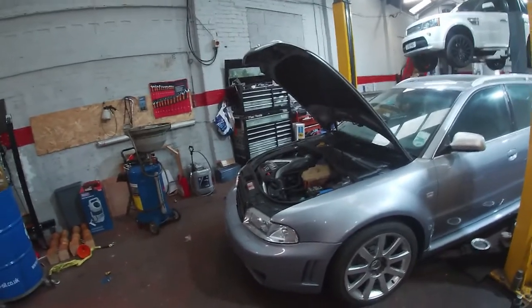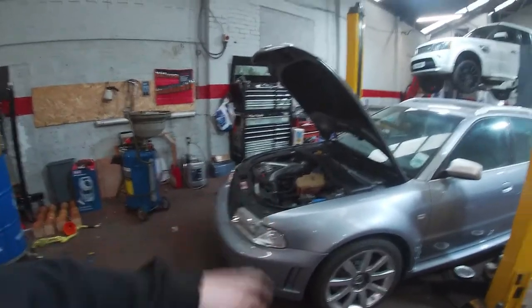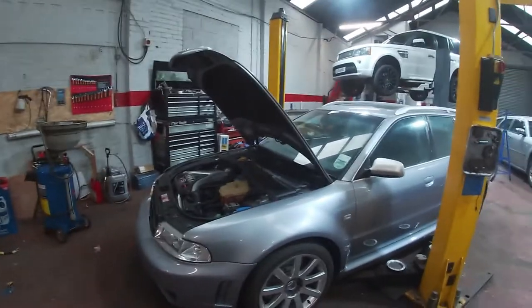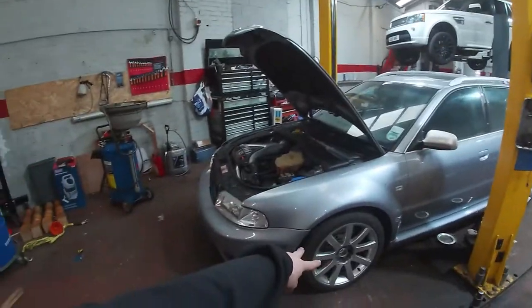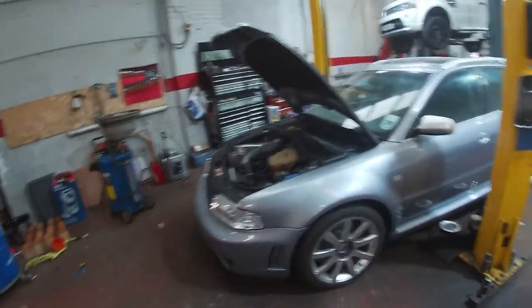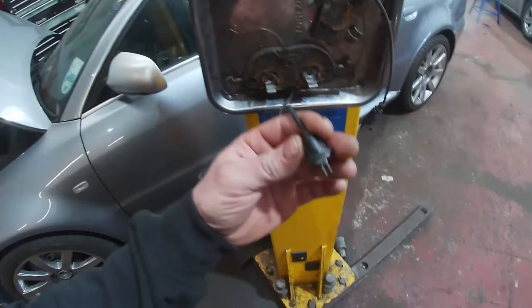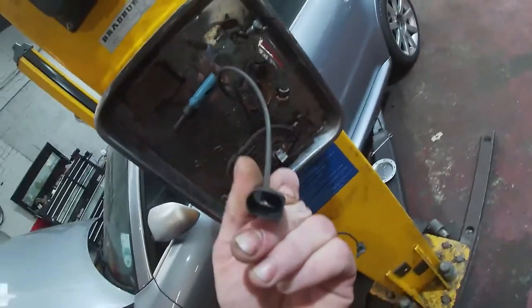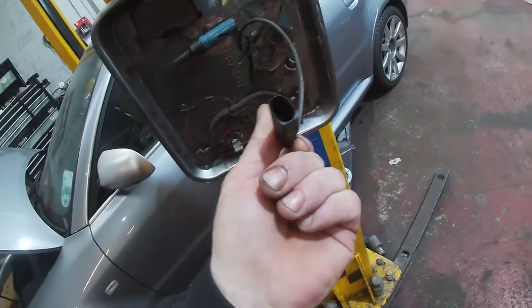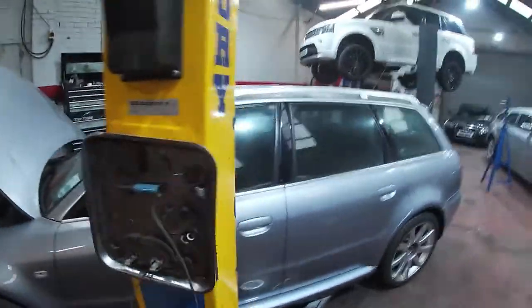When my glamorous assistant's back in on Monday, we'll get somebody sitting in the vehicle. We'll also get the big diagnostic tool on it and just check that that warning light is relating to those front sensor wires. I reckon it will be — these were the two that were all rotted. Both sides — you can see it on the pins there. A little bit on the rear but nothing to write home about. You can hear the idle starting to come back down on it now.